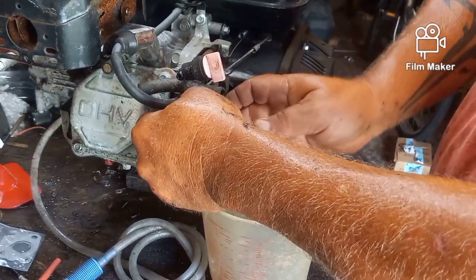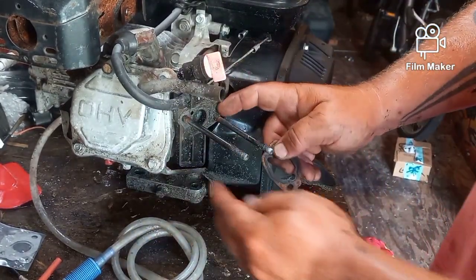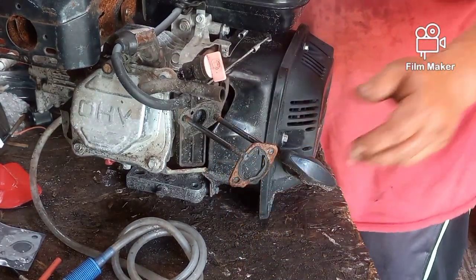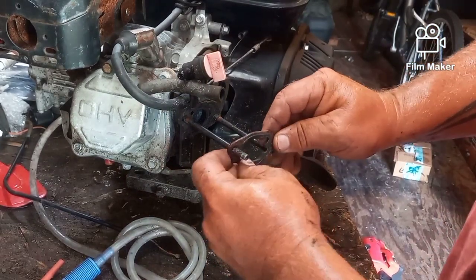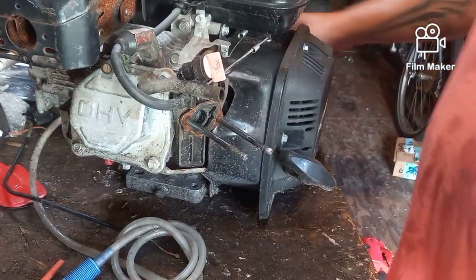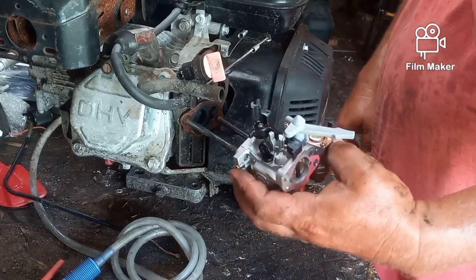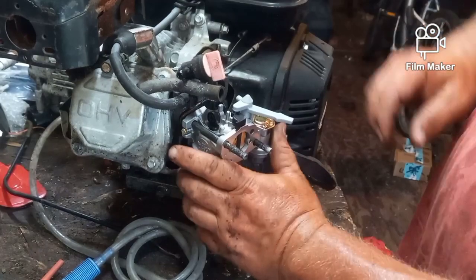And then just to show you, this is a metal slug that goes on. There's a gasket that goes on behind it. Then the slug. Then there should be gaskets that came with this that I have to find. There they are. In this little jobby here. And then there'll be a gasket that goes in there. And then our new carburetor goes on, and I'm not sure. Yeah, it should go this way. That should, if I put it in the right spot, just feed on like so.